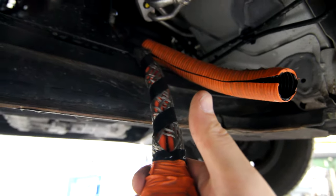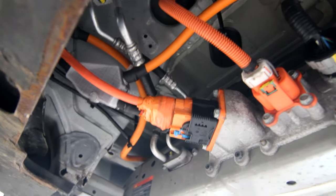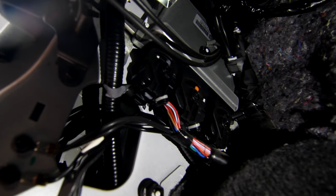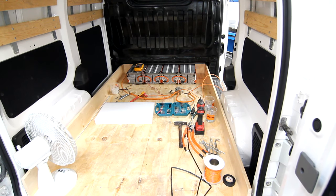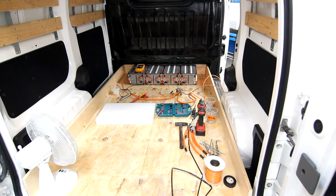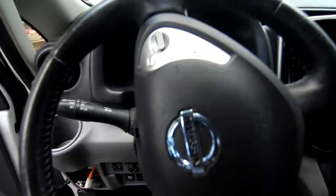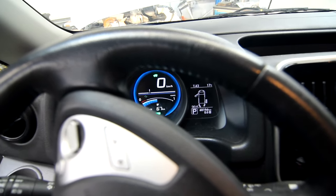This cable end is actually sealed, so inside the contacts there's no actual water ingress. This is different from the Leaf — we haven't encountered any water inside the Leaf cables yet. I'm done with the splice. There is a 2011 Leaf VCM with an almost identical pinout — very slight differences — and the CAN bridge is installed as well. In fact all the low-voltage electronics are identical to any other Leaf we have.